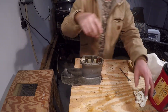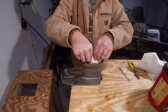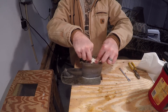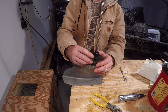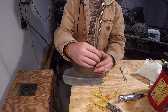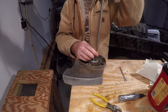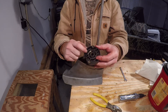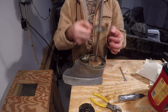You can stuff a paper towel or an old rag down in here and that'll keep the oil from getting all over your floor or concrete. Next thing you want to do after you remove the split pin is remove the water pump impeller housing - do that through these four bolts. Once you have those removed you can simply slide it up, and there's your housing, your water pump impeller, the gasket, and the plate.